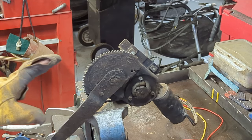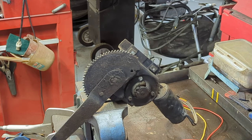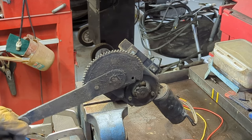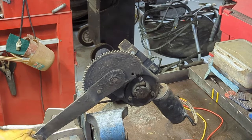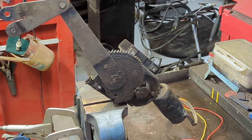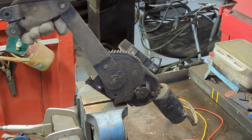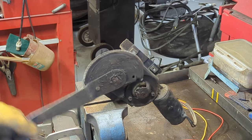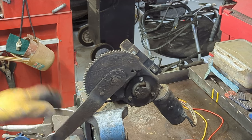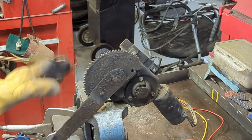Reverse order is: reverse the electricals, bring it up, and let it feed back in. Once it's fed back in, there's no danger. I've reversed the lead — put the red lead on the center pin of that three-prong plug — and this is how you do the preload. Pull up on it, and that's it, she's in there. So let's reverse it and take it off again. There's your preload. Just hang on to it — there's not a great amount of tension. But you want to make sure it's clamped in well.